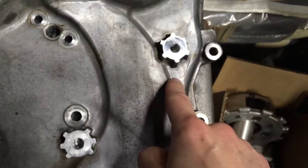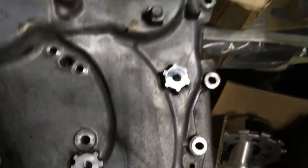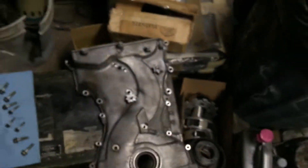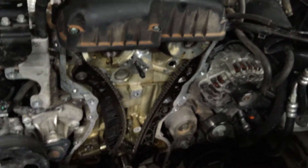I'm just waiting on a couple gaskets and a seal for the front crankshaft. This was the piece that was broken on the old one — it was cracked all around here. You really couldn't tell unless you put weight on it because it was a hairline crack. But once I tensioned that belt down, it kept throwing belts off, so eventually I figured out what the cause was.